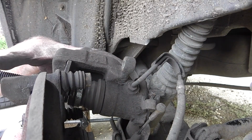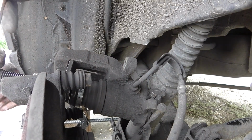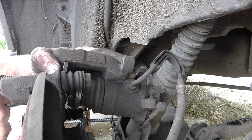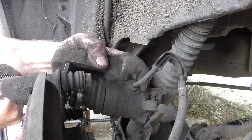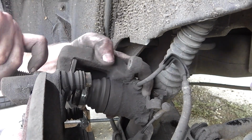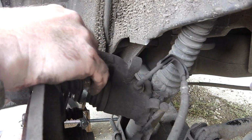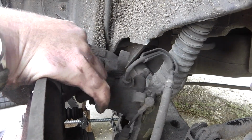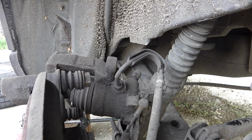I have had one of these in the past where it was jammed. And where the cylinder was turning, the rubber was jammed to it and this got in a great big twist. And if I hadn't noticed, it would have ripped. So I had to ease it off and kind of open it a little bit. Put some grease on it. Silicone grease, not organic grease. And right, I'm going to try and turn this around again.